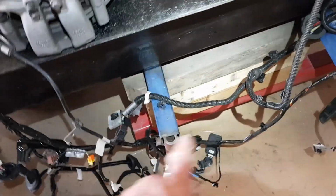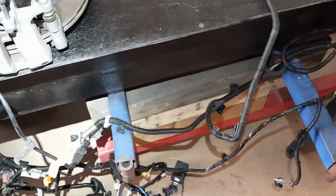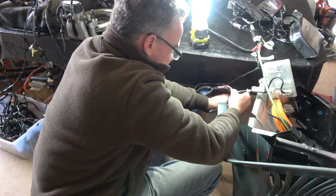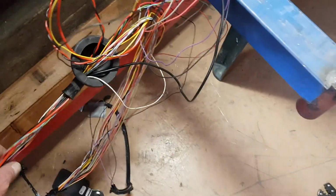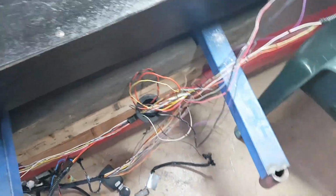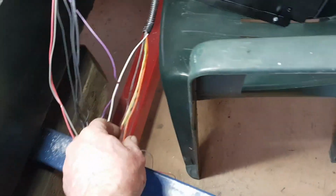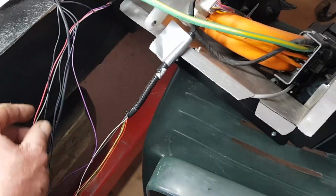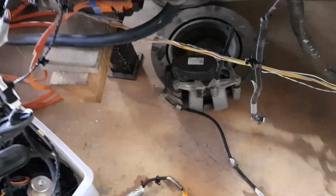So I'm going to have to start going back into the wiring harness to relieve those wires so I can get that back further. Yes, that's why I don't like unwrapping it if you don't have to, because it starts looking like a rat's nest. It's fine though. So this plug now reaches. We have success. Lengthened the white charge port controller and cut where it's ground in there.